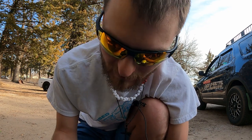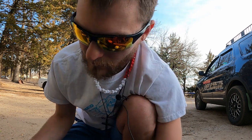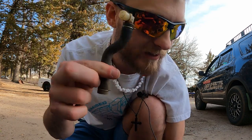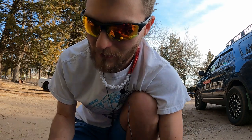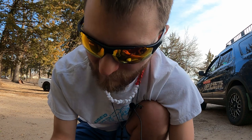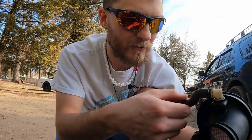Get those rings cleaned up, then we'll get the plastics off, get the carb out — all before we put that air filter back in. This little hose here goes on top of the motor into the side of the air box. We're going to clean this as well with some carb cleaner — just a nice little spray, doesn't need a whole lot. Wipe it all down and that will go back inside, just like that. Then hook the bottom one back onto the motor.